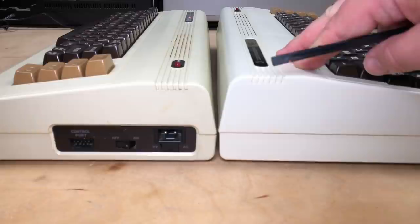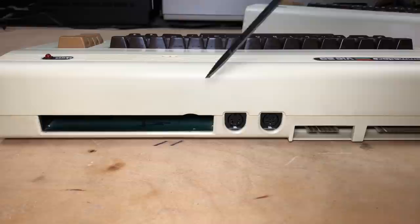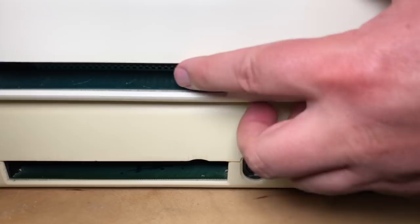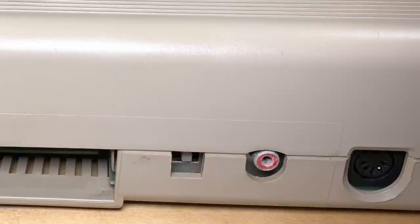Now, strangely, this VIC still has just the two-prong AC. It's not the cost-reduced one that was inspired by the C64 either. And as further proof that this is the same shell from the C64, notice this little notch right here. It's just this little rounded area here that seems to serve no purpose on the VIC-20. And on the PET style, it's just a straight edge. But here on my silver label C64, we can see that that notch is actually for the RF connector here. They added this little raised bit to give enough clearance. It's still barely enough on some other boards.